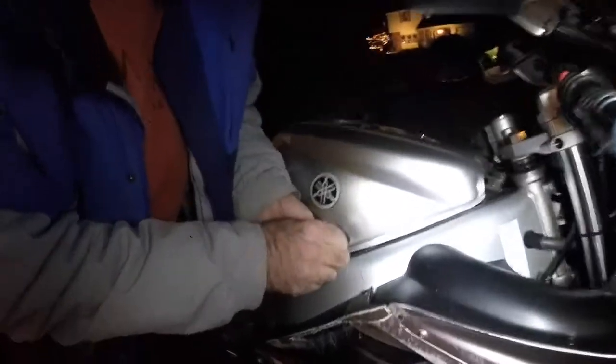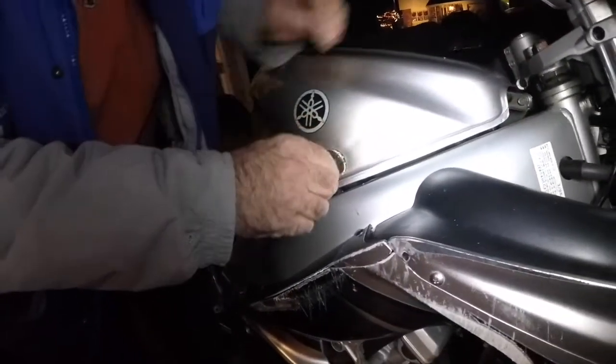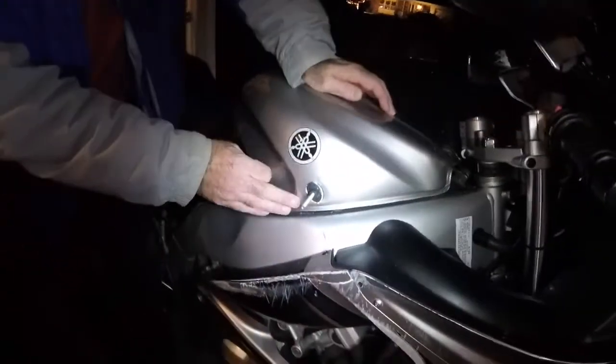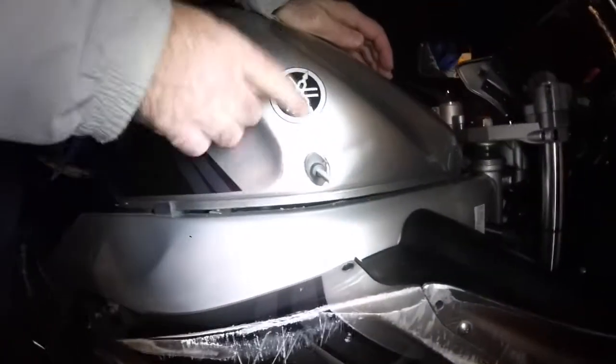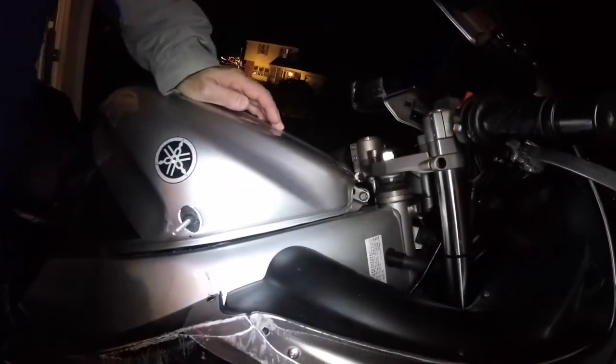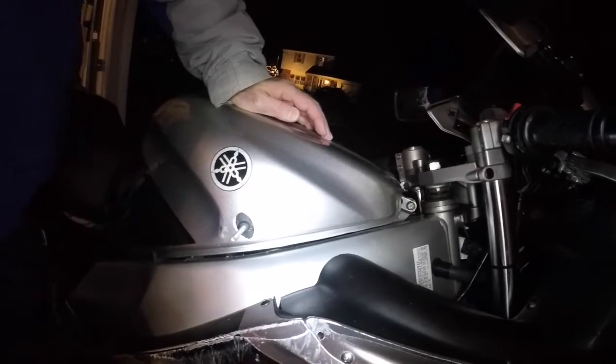Right, so we pulled a lot of the dent. It came out a lot, so we're just going to keep going. And this section looks good here. I mean, this is going to need body work. We knew that. But we have to get it so it's within an eighth of an inch so we can fill it with body filler.